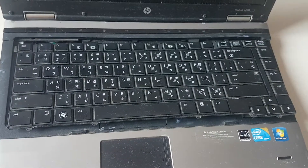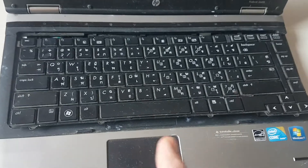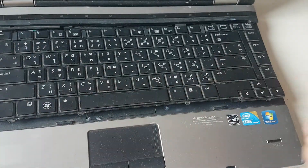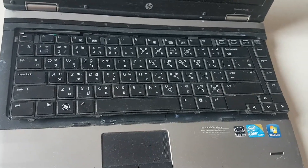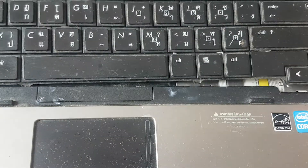In the process of doing this work, I picked up on how fairly straightforward it is to service these machines. I won't show you because I'm holding the camera with one hand, but underneath there are three captive screws which I think you've got to use Torx on. Don't strip them with anything else or the wrong head — just get a miniature Torx set. These hold the keyboard in. The keyboard has got some little clips, little pokey things here.